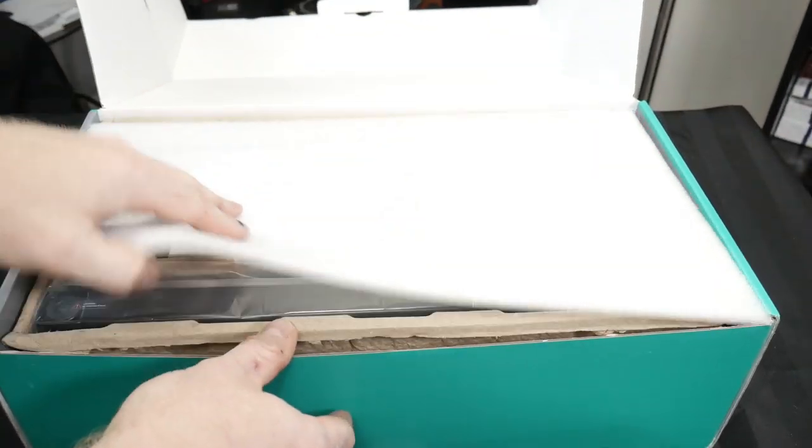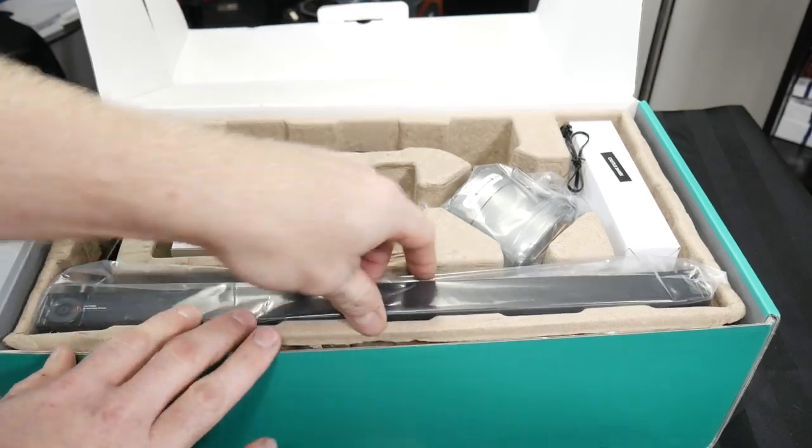It's actually a really good cooler — I have one — and DeepCool said they were going to take care of this. They implemented a new patented system where something can expand and contract with the pressure as the fluid changes temperature. It exhausts a little bit of air from inside that bladder, squeezes out, and when things cool down it contracts back, making for a leak-proof system.